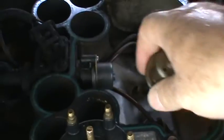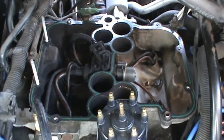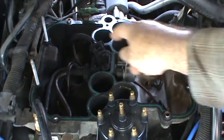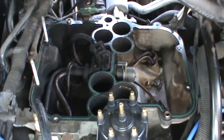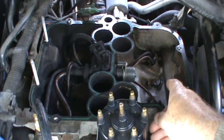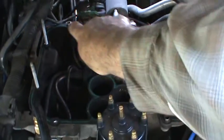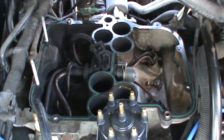Here's what the old one looks like when not installed, and that's the installed new one right here. Now, this is where the air goes down into the lower manifold. If the top were on, it would be taking air from the air filter housing back into those two big runners - round on one end, square on the other - dropping the air into either side. Depending on what that dual split valve is doing, the air goes up into the lobe or runner and into its corresponding hole. It's gasketed, so it goes into three ports on each side.